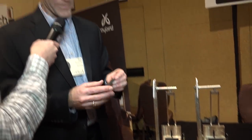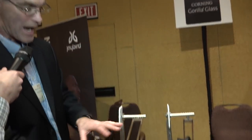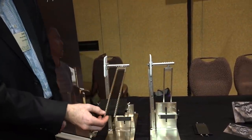What we've done with Corning Gorilla Glass 5 is improve the damage resistance even further, driving drop height survivability up to selfie levels. We have a demonstration to simulate that drop event where we'll impact on 180-grit silicon carbide sandpaper, which replicates those sharp contact surfaces like concrete and asphalt. We're going to simulate a drop inside this pendulum that replicates the impact energy of about a one-meter drop, or about waist height. I'm going to go ahead and drop this sample.